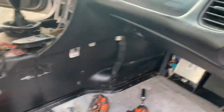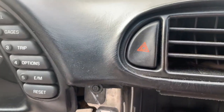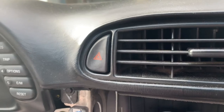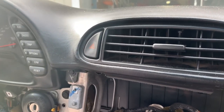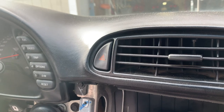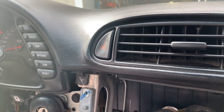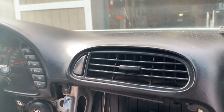Another thing to note while it's on my mind: I haven't pulled the dash out yet, but in these cars we've got our hazard switch up here in the dash. I don't know why they did it this way, but there's a bunch of stuff that actually runs through this hazard switch. It's kind of tempting to get it out of there and put in gauges or whatever, but you're going to want to hold onto that. If you disconnect it and don't reconnect it, you're going to find that your center brake light works, but the two brake lights on either side in the rear won't actually function without it and without doing some other wiring to replace it. So I'll be hanging onto that - I held onto it in the other car as well.